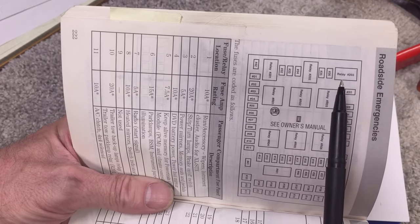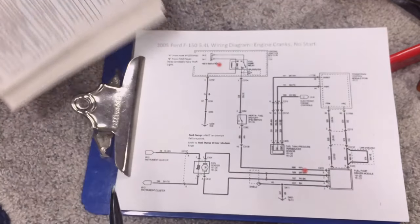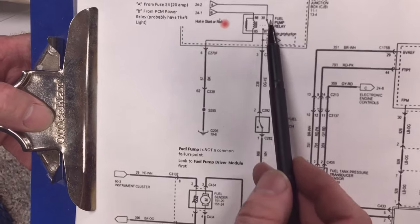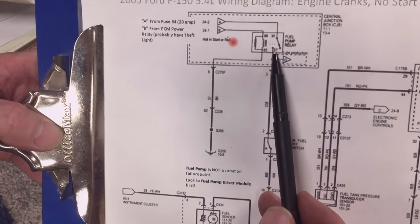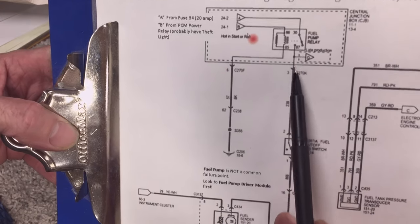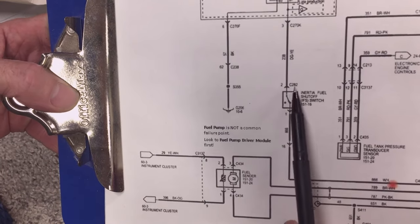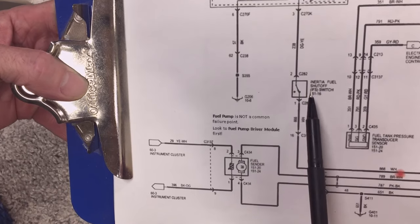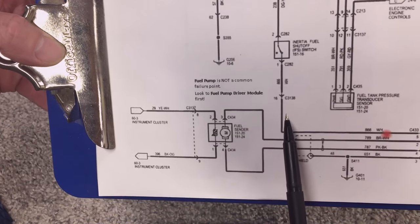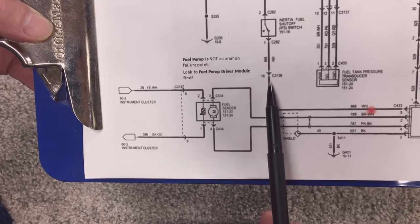The fuel pump relay is not a replaceable relay like the rest — it sits on the board. When I pull out the relay in the fuse box, it energizes and de-energizes and seems to be operating fine. Power goes through the fuel pump relay, which clicks on and off when I turn the key. You can put your finger on it and feel it energize and de-energize, so I think this relay is probably okay. Then I go down and measure voltage before and after the inertial shutoff switch. I push it in to make sure it hasn't been actuated, and it hasn't. I measure voltage going into and out of the switch, and I do have voltage on both sides.